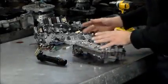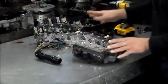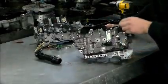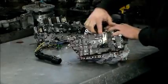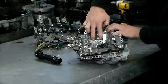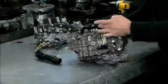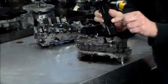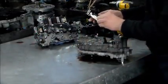This valve body is actually easier to maneuver without the big piece on here, so I took it off. Turning the valve body over, you have your input speed sensor, your carrier gear speed sensor, and you've got a couple of seals in the case that are going to seal these two. If you ever have the valve body down, make sure these two seals are in the case. You've also got a couple of accumulators here. This speed sensor actually has a separate harness that plugs in right here to the main internal harness, so I'm sure that would probably be available separately.